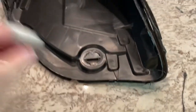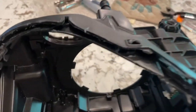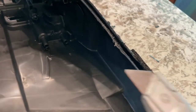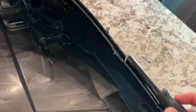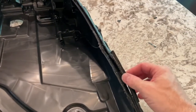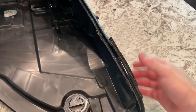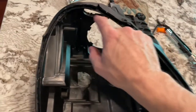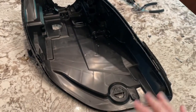The remnants of the lens are out and now we've got to take care of this channel — there's old butyl all in the channel. What works best is a combination of getting an old screwdriver and just scraping, and also continuing to cut out bits and pieces as you can. These little hook tools are also helpful for removing butyl. I did damage my housing a little bit, and that's going to happen. If you seal it later with enough butyl to fill it all in, you'll still get an airtight seal. It's important that we clean out all of this track where the new lens is going to mount.